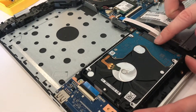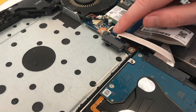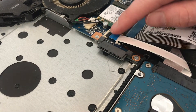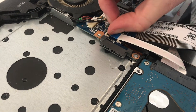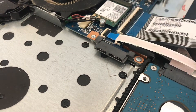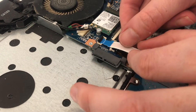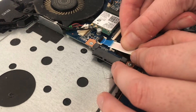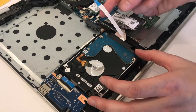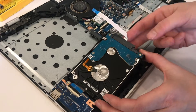This is the hard drive. To remove it, follow the connection to its end right here. There is a little black bar on top — that's a tiny hinge — and we're going to lift it to open the connector. Flip it open so the cable can be pulled out, and you must be very, very gentle with this, as these connectors are very delicate. Once it's free, being careful not to crease or bend the cable, you can simply lift the hard drive right out of place.